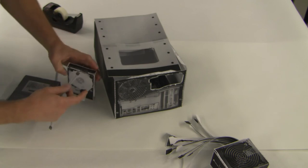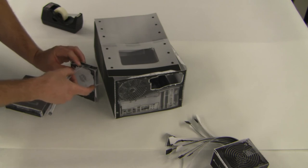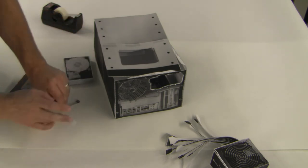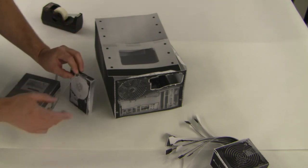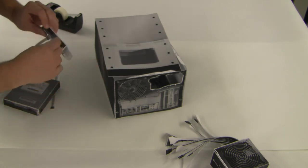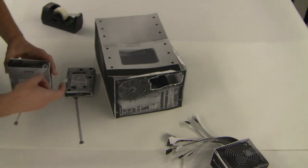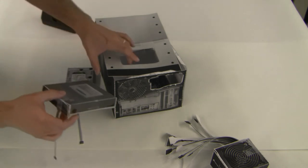You'll see on the back here it's not exactly correct — the sizes on this are a little bit off. But basically with SATA, you'll notice the ports: it has a small SATA and a large SATA. The small one is for data, and that's going to plug into the motherboard. The large one is for power, which is actually going to be a different cable coming in off of the power supply. So let's go ahead and attach those first outside the case, and then we'll slide the drives in and be ready to make those attachments onto our motherboard.